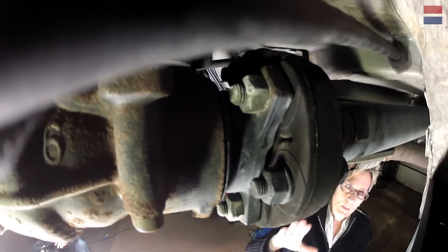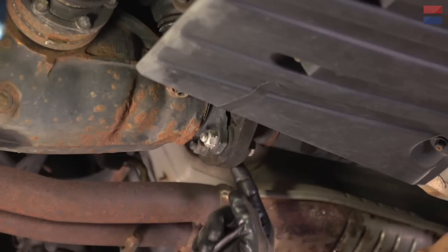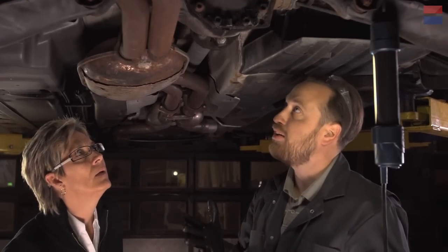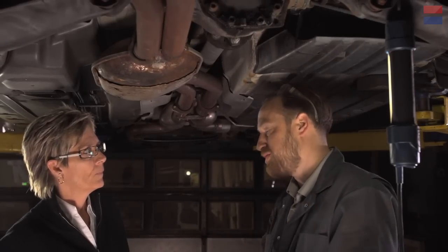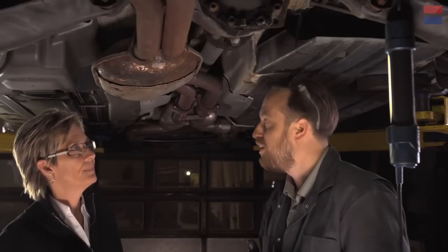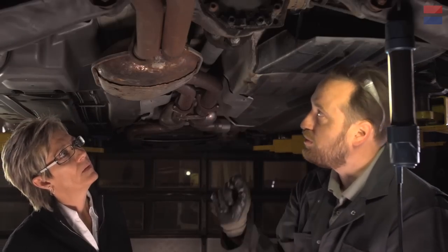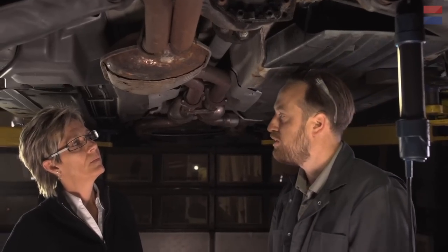What would make me know there's a problem? If you actually inspect it closely, you can see there's a crack in there — the rubber started to degrade. That's probably hard to feel at this point, but what you're going to feel as it gets worse is as you step on the accelerator, you'll feel a chunk almost. As it gets worse, it's time to replace it. It should be a relatively easy job — pull these bolts out, slide the old disc down, put a new one in, bolt everything back together. It should be good as new.